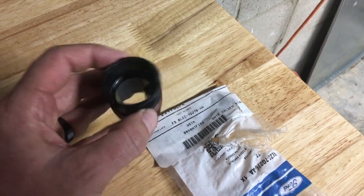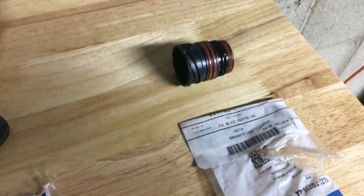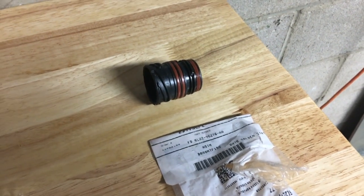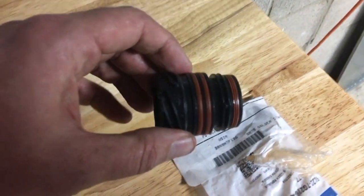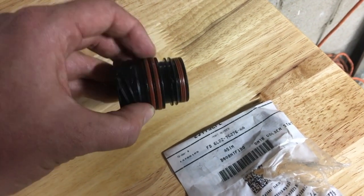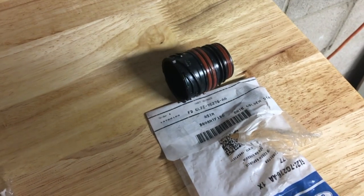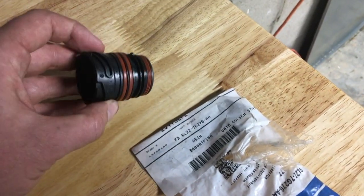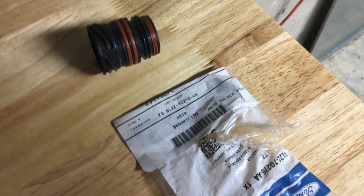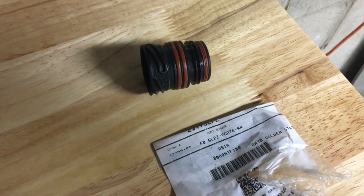To recap: the repair was this sleeve for the bulkhead connector in the back of Ford transmissions. It's in a bunch of different transmissions — my Raptor is a 6R80 but I think the same connector is also in the 6R60s, which covers a whole bunch of different vehicles. What happens is these original o-rings wear out and you start to get transmission fluid blowing past them, dripping down the back of the transmission. It looks like a leak in the corner of the pan, but what's actually going on is this sleeve just needs to be replaced. It's a pretty cheap part — got mine on Amazon for about $20.